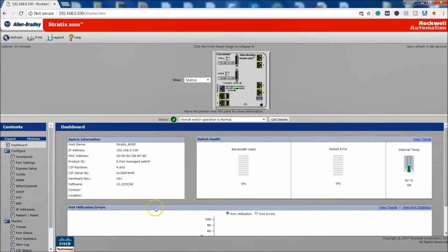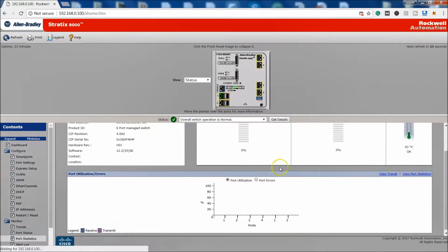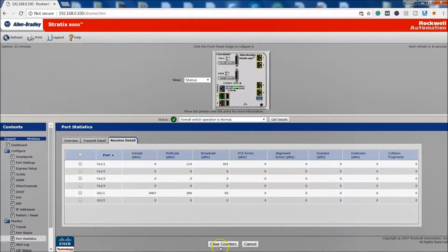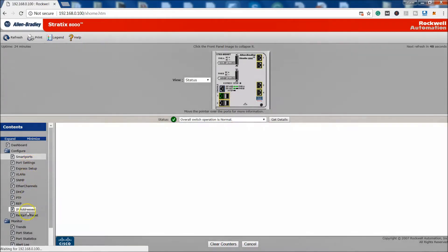Back on the dashboard it's the same scenario — you can start connecting devices and seeing activity. You can also come in here and look at port statistics to see what you're connected to, how fast packets are moving, or how many you're missing. You can clear the statistics and come back to see what packets are coming through — it's very useful for finding information about network activity.